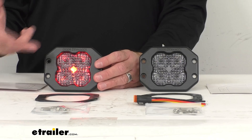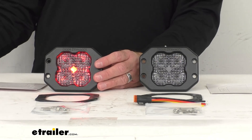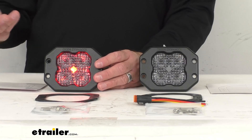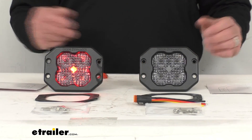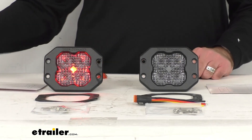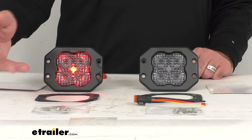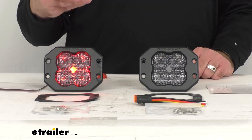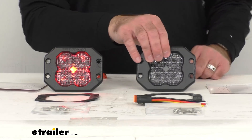this actually has lens patterns molded directly into this lens surface. That's going to prevent the normal efficiency loss you see with having an additional outside lens. When you shine light through any type of glass or plastic, you're going to lose up to 10% of that light just from it shining through. So by making it a part of this lens, you're not going to lose efficiency, but actually pick some efficiency up.